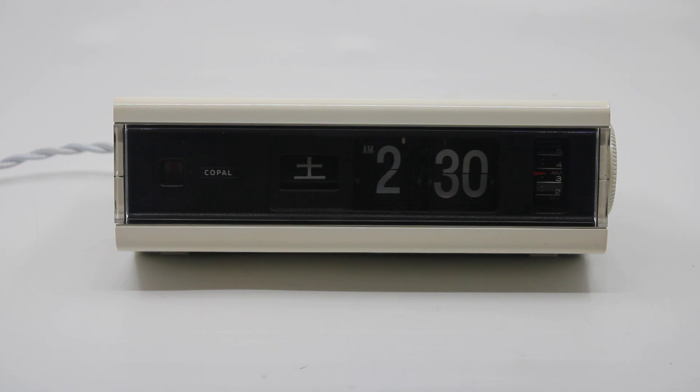I'll leave it up to you to find which sign is which day. If I'm not mistaken this should be Saturday, but don't hold me to that — I could be wrong. It's a 12-hour clock, so here it shows either AM or PM, and it is 60 Hertz. Normally these clocks from Japan can have a switch for 50 to 60 Hertz; however, the motor in this clock when I got it was dead and beyond repair, so I needed to replace it with another motor. I rebuilt the gearbox with an American coil, a US coil, and that means it doesn't have a switch — it's just set to 60 Hertz, a 60 Hertz gearbox.